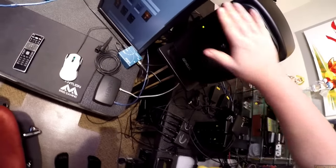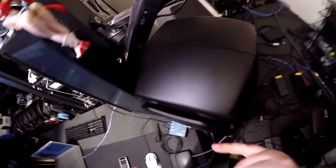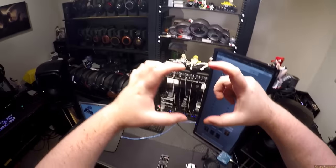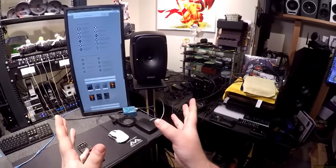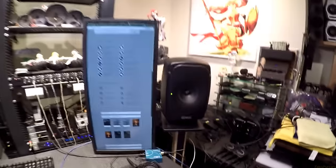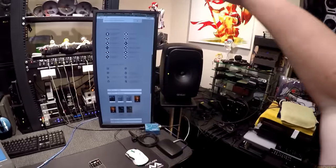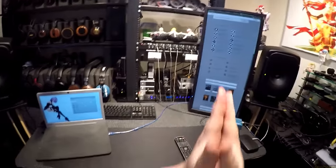The driver size, what size driver is it? I'll have to show you. You see there's a fascia of aluminum, right? This is a giant aluminum waveguide for the mid-range and tweeter. Behind it there is a 6 5/8 by 3 1/2 inch shaped woofer up there and at the bottom. And I don't know how you make this work with the configuration where two of the drivers are literally hidden behind a block of aluminum, but they are, and they project the air up and down. There's a huge port in the back, which we'll look at when we get them off the stands.